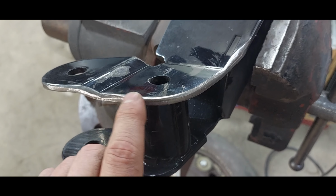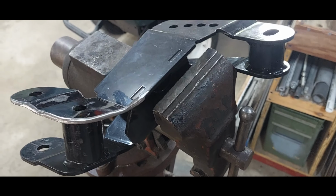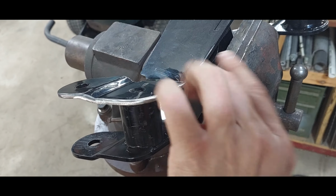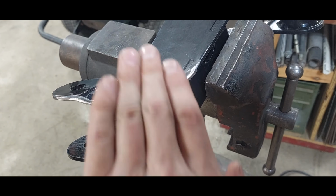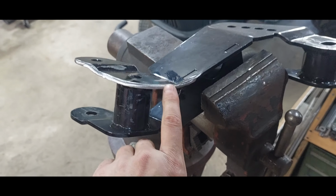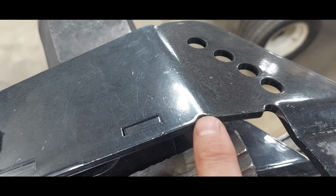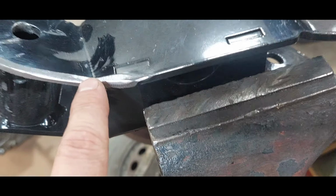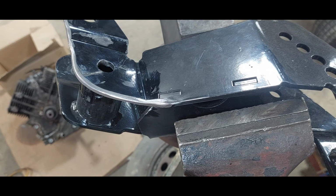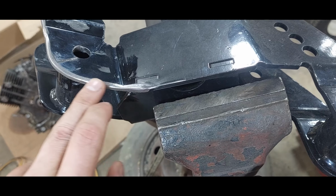I also had to radius up through here. I had to radius this edge over a bit, as it was interfering with the chassis bracket, which kind of cups around this pocket, so it's dimensionally curved this way. It's got a lot going on. So like I said, I ended up losing about an 1/8 inch, because you can see this divot here where they put this brake in it. There was one identical to it here where this brake is, and yeah, I took the metal all the way down past that indent, just a smidge.